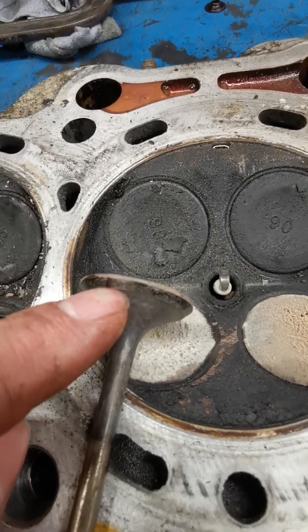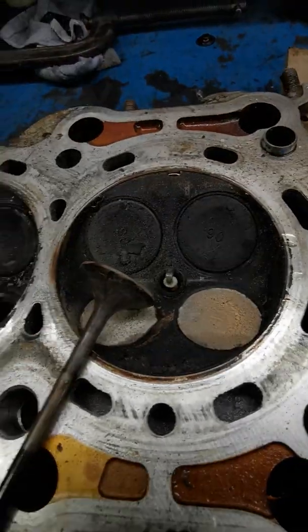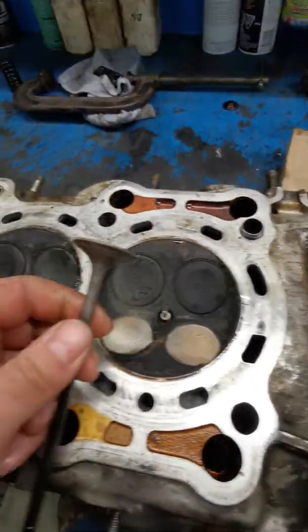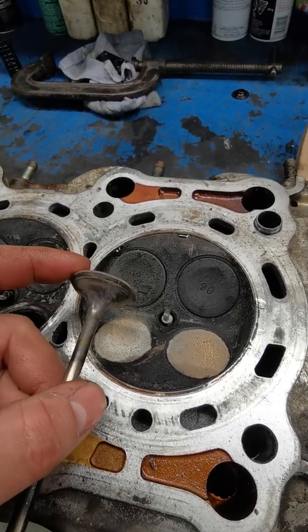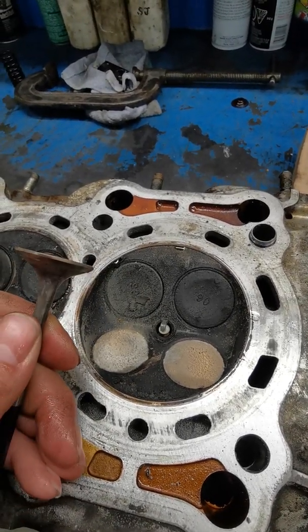But this secondary line under here, that ridge, if you smooth out that ridge, you smooth out airflow throughout the head, especially on the intake valves. It's an old hot rodding trick. You can actually learn it on Uncle Tony's garage. So while they're out here, I'm going to chuck them in the bench drill and just file that smooth. I'm going to clean these up.